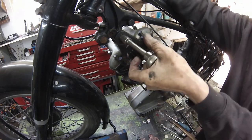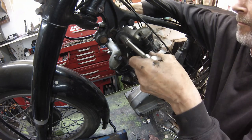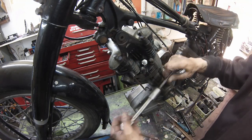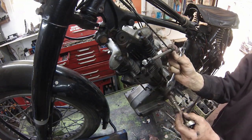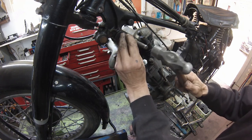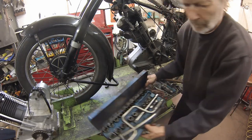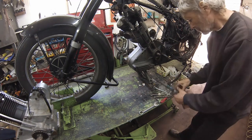I guess you don't need reminding of P&M's unique and patented method of saving on front down tubes by replacing them with an engine. A pair of hangers, two thimbles and a stud make connection to the headstock. Slip a scissor jack under the crankcase to support it, out with the stud and bop each thimble with a drift from the opposite side.